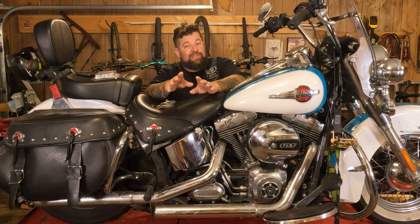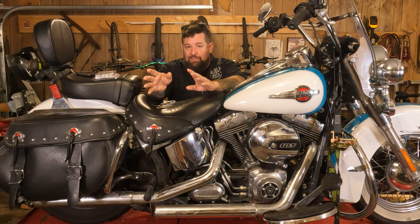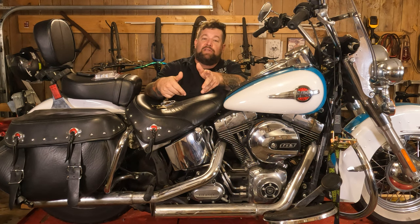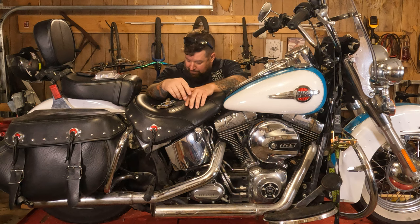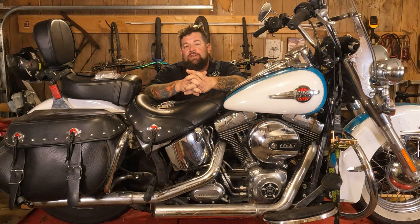However, there are a lot of things you got to take off the bike to get to the swing arm. Don't get intimidated. Just look at each one like it's a small, easy task, and most of them really are. Got to pull the floorboard, pull the exhaust, pull the bags off. And that should be most of it. Then, of course, pull the rear wheel, pull the brake caliper off, and undo the shocks and the swing arm bolts, and it should just fall right out of there.